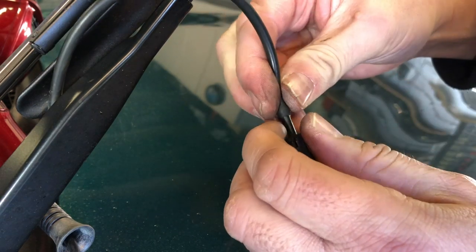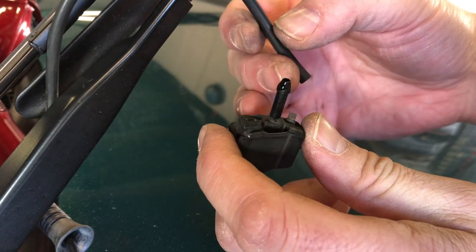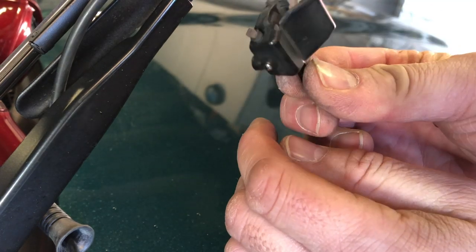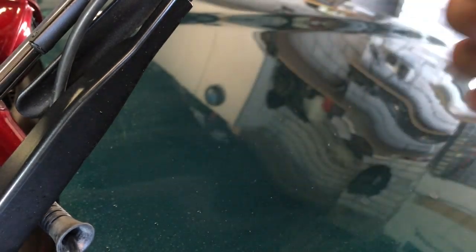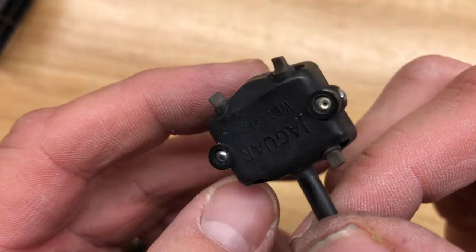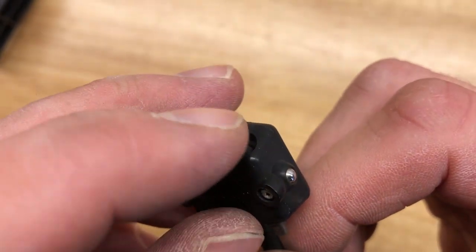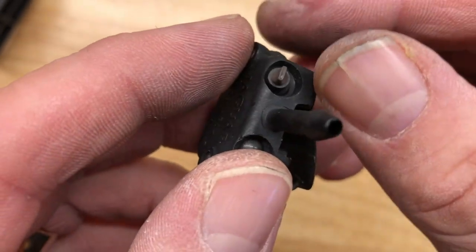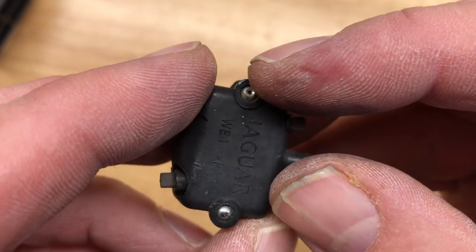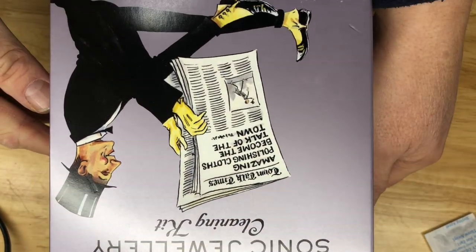Peeling back the edge to release it — got this close, don't want to break it — and there is the nozzle off. That's the driver's side on my UK car. Here's a better view: quite a sophisticated little thing. Rubber duck-bills there, there, there and there, and a sort of traditional ball jet that you can adjust with a pin.